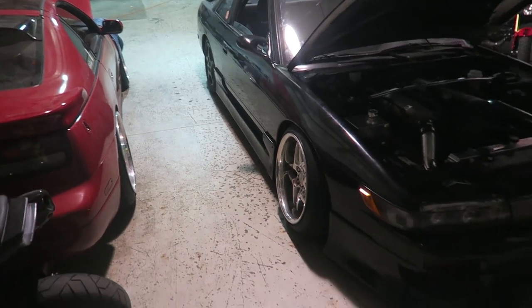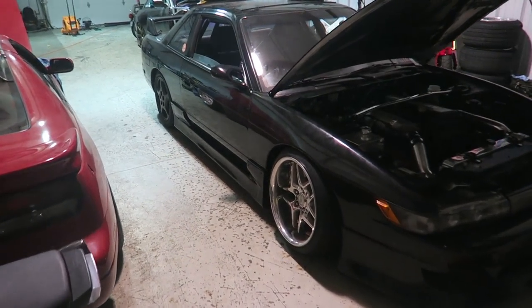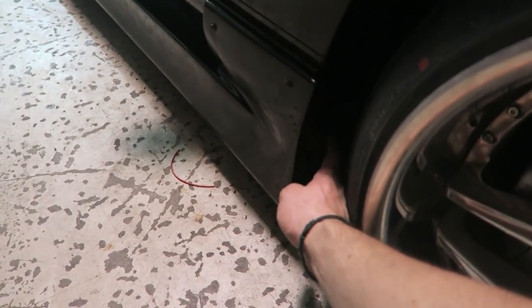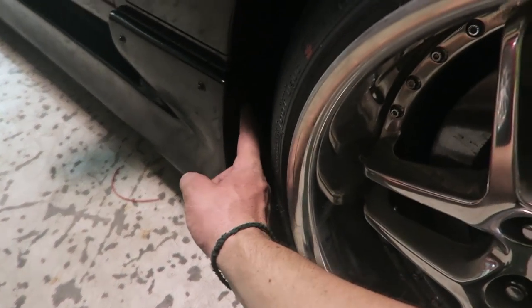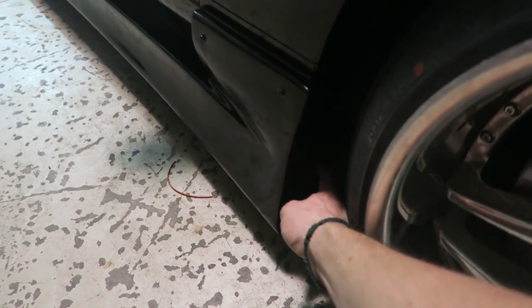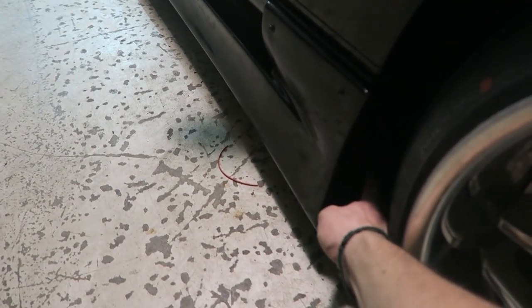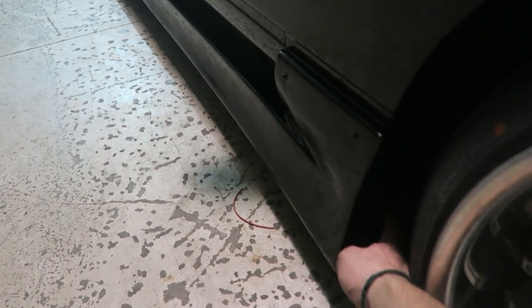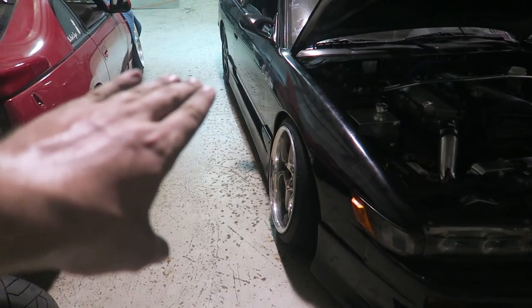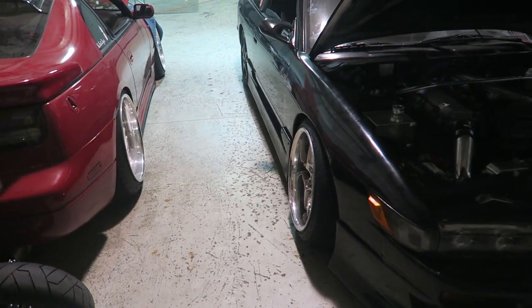These aren't as aggressive as my last side skirts, but since they're poly I can kind of stretch them. If I mount them on the bottom, use my inner fender and kind of pull it out a little bit, and mount it like that, it'll give it a more aggressive look — and I like that. With fiberglass I couldn't do that, it would just crack. So I'm gonna try that, give it a little bit more arch in the rear by stretching it out, mounting to the quarter, and we'll see how that looks.